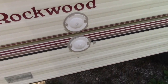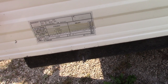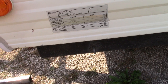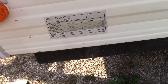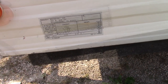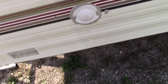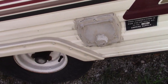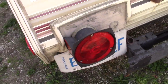On the sides here you can see the manufacturer's certification labels. The maximum weight of this one is 1,500 pounds and it also tells you your wheel size, the date of manufacture, and a few other things. I've got a couple of blank-off plates here which means they've removed the plumbing. Over here is the connection for electrical, which has also been removed. Make sure all of your lights are there and make sure your lights work.